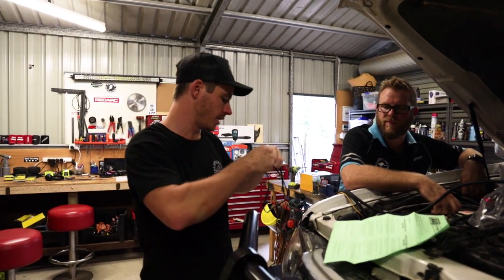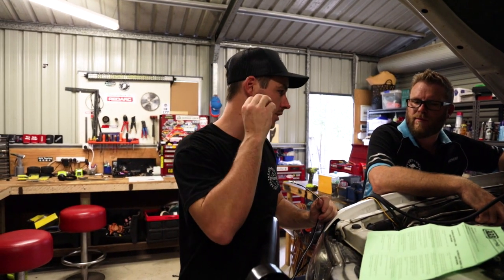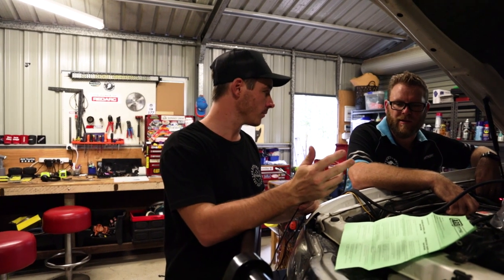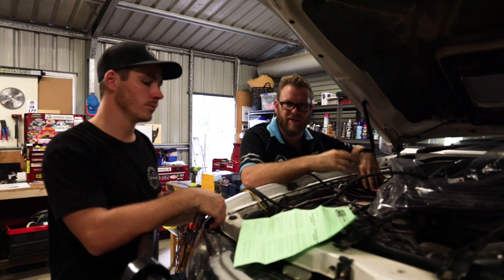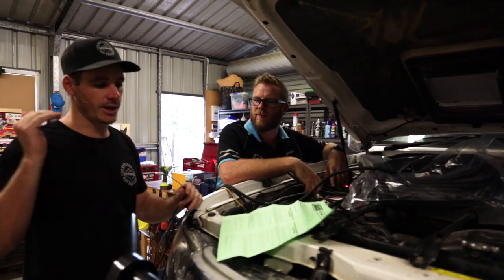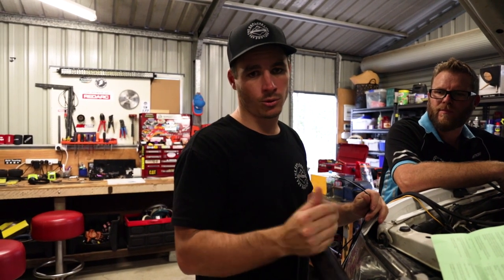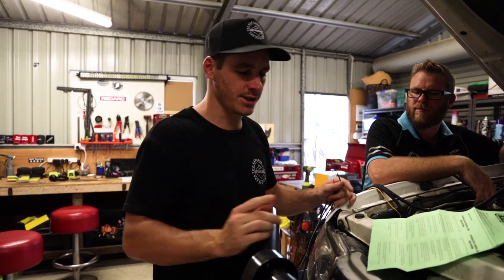For legal reasons, your spotties must be switched through high beam. That way if you dip to low beam you don't need to find another switch on the dash — it automatically dips the spotties with your headlights. Essentially, if you're driving and a car is coming your way, as soon as you knock off high beam your spotties automatically turn off for safety reasons. Nice and easy.